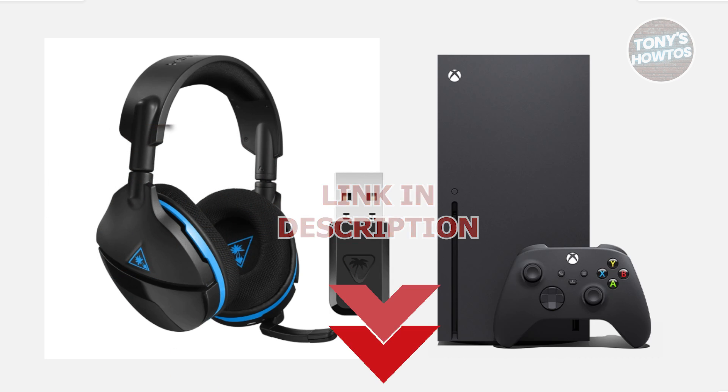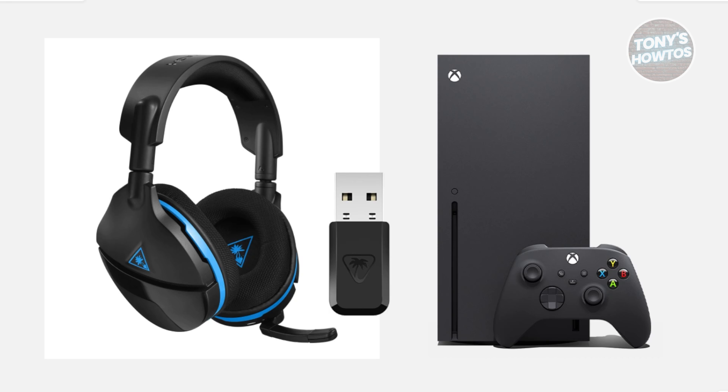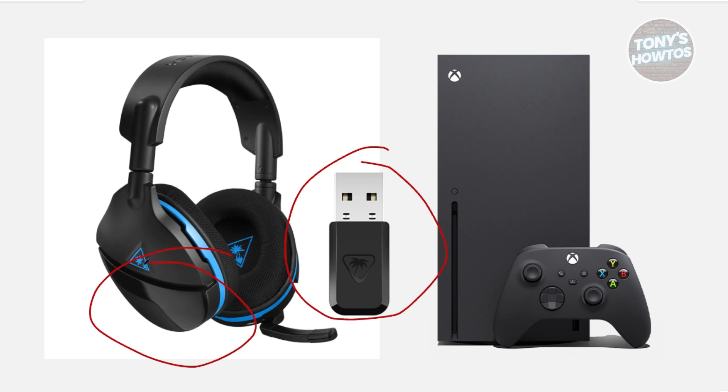There are actually two ways for you to try to fix this issue. The first way is the standard thing you may want to do first. Usually there's a syncing problem with your headset. To fix this, plug in your Turtle Beach transmitter into your Xbox or your device. Press and hold the power button on your headset — don't just tap it, just press and hold it. Your Xbox should start searching for the headset automatically. Once you notice the Xbox looking for a connection, release the power button. If you see the red light blinking on the headset, that means it's trying to connect. Give it a few seconds — this usually does the trick.